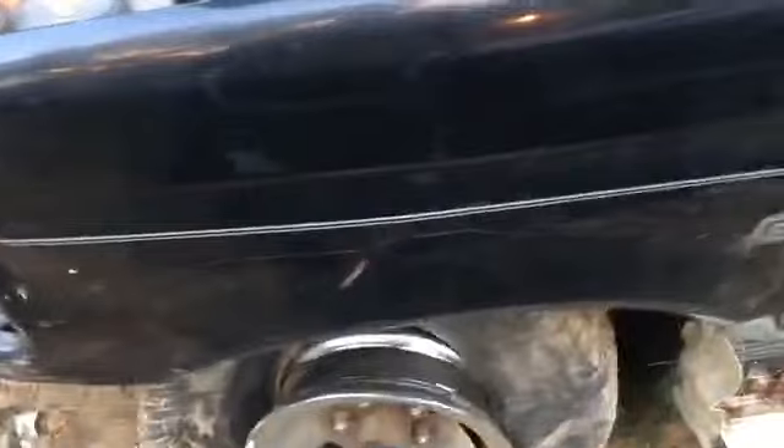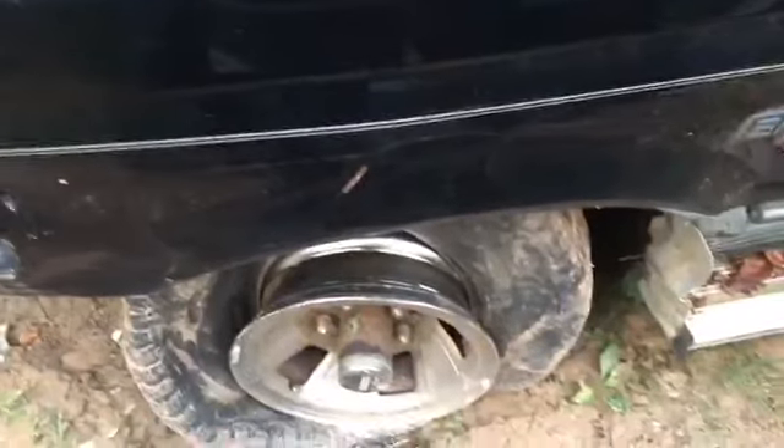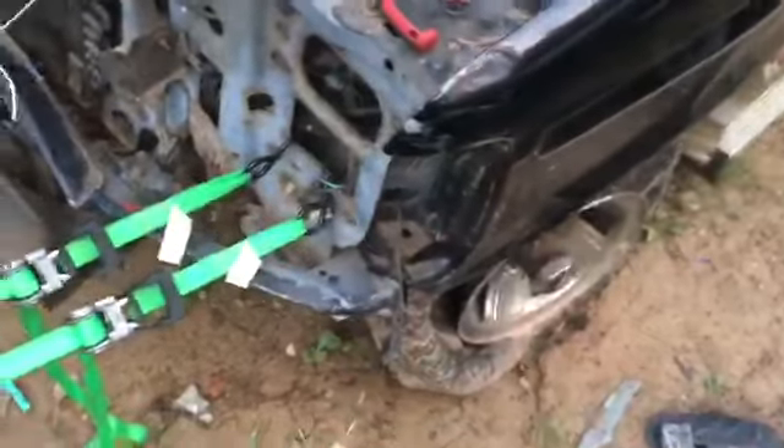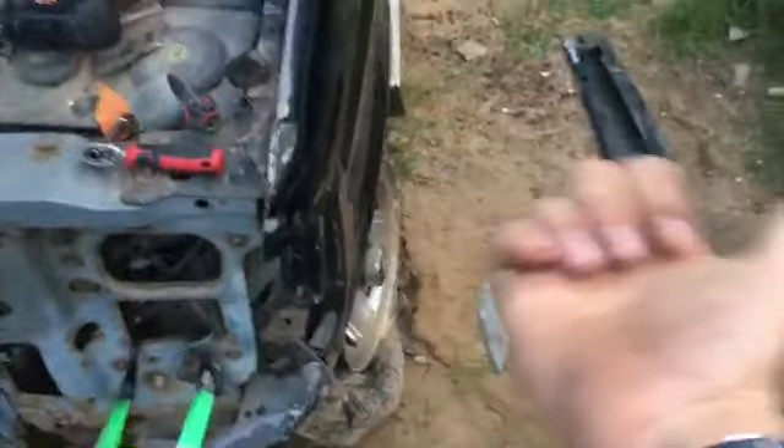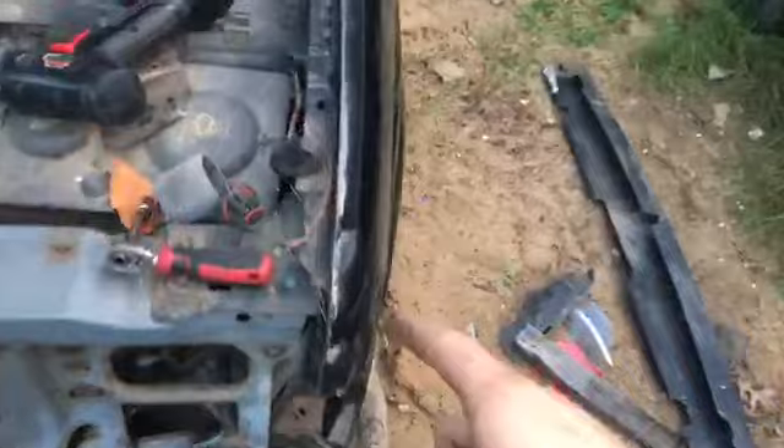I do see it's going to actually push this fender back out, which is fine because it is actually bent in inward. As you can see by that crease right there, I need to hammer it in. I'll take a sledgehammer to it. That might actually help to try and pop that out some more too. I'm going to take the slide hammer and C-clamp, clamp it to that radius right there and yank it this way. If I knock this bow out of the fender and push it in, it's going to try and straighten the fender.